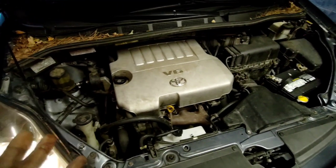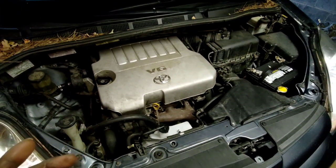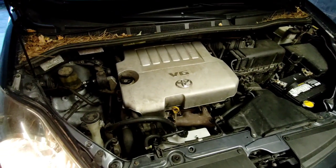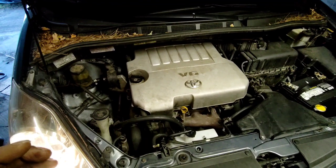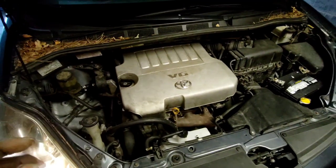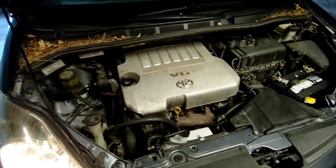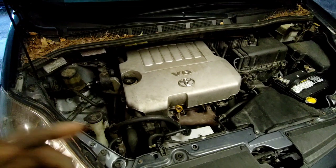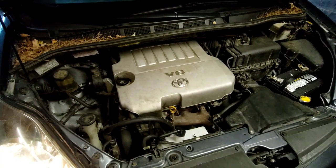But yeah, the labor time on this is supposed to be about an hour to 1.2 hours for the CV axle. Unfortunately, you can run into problems. I did take the housing for the carrier off of the CV axle. It was a waste of time because there was a bracket stuck up at the top. Didn't work out that well. So I wound up putting it back, tried the heat. The heat didn't work.